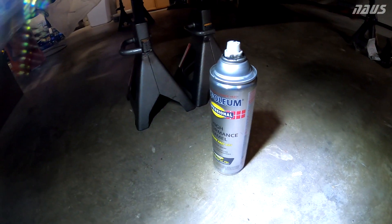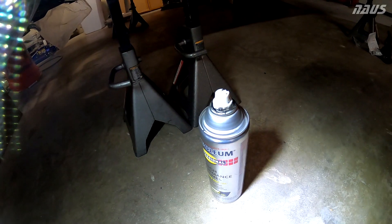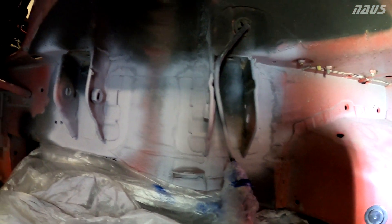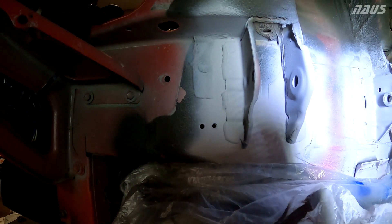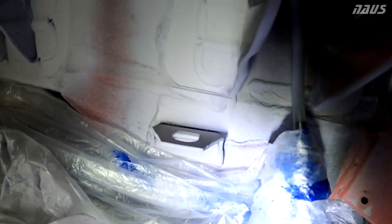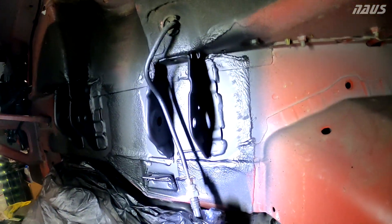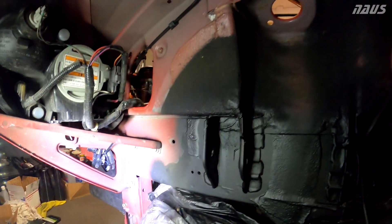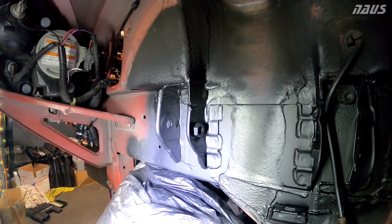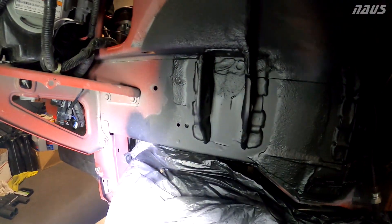I'm getting ready to apply the first actual coat of black paint — this is the Rust-Oleum Professional High Performance stuff from Home Depot, flat black. I just used automotive primer all over that clean metal, and got it up top too since the wire brush hit up there. I also touched up the brake line bracket because it had some chipped paint. This is with the matte black paint — two coats finished. Now I'm going to hit it with some bed liner. I'll put the bolts in and mask off the raw steel so I don't get bed liner in the threads.